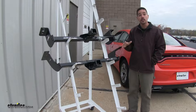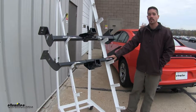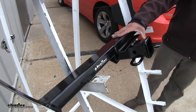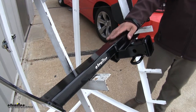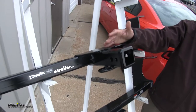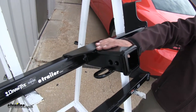With all that in mind, you always want to double-check your Charger's owner's manual to make sure you don't exceed the manufacturer's recommended weight. Also, with the Curt, they do recommend that anytime you're towing a non-trailer load — anything not supported by tires, like a bike rack or cargo carrier — you use a stabilization strap, available on our website using part number 18050. With the Draw-Tite you are not limited to that; you just want to make sure you stay within the manufacturer's weight limits.